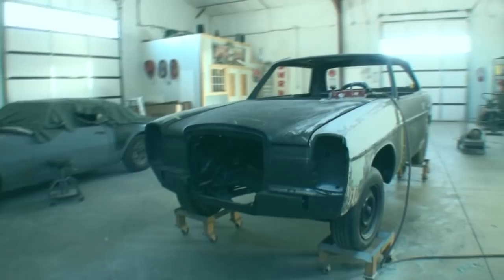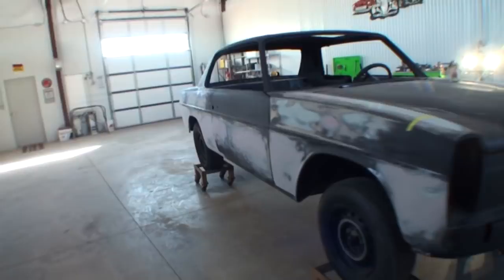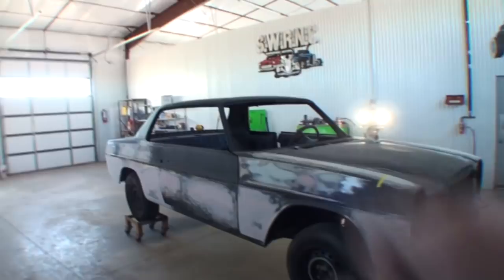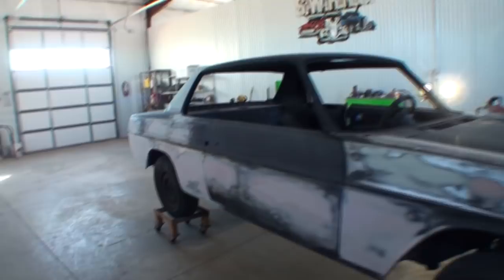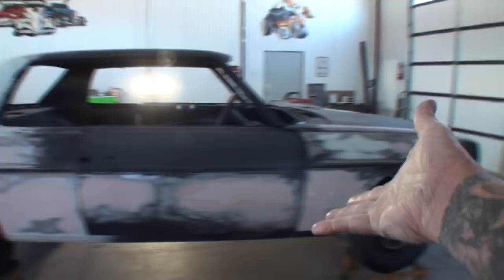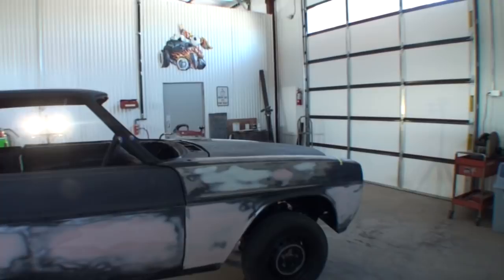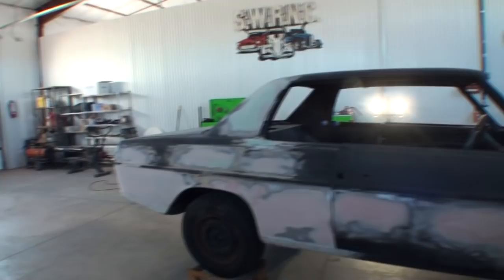This was a major restoration job and you can kind of see by what's going on over here, all the bodywork that needed to be done. We're not talking rust repair right now — just bodywork only. The bodywork on this car was very, very extensive. Before I did any filler work, which we'll call Bondo, I did a lot of hammer and dollying and also used my shrinking disc, slap hammers, and dollies — everything I needed to get the bodywork to require as little filler as possible.